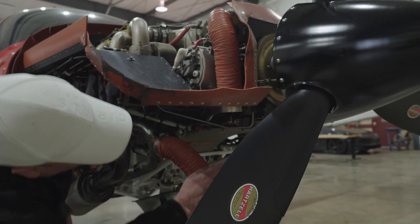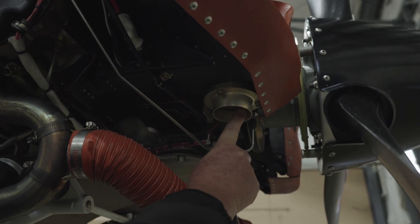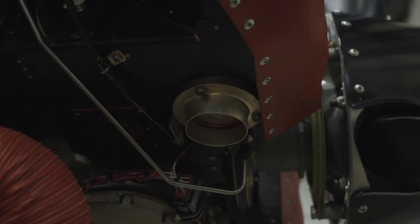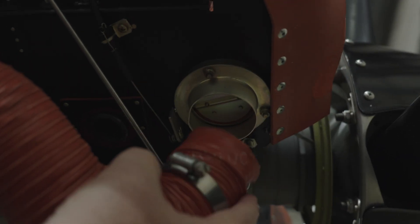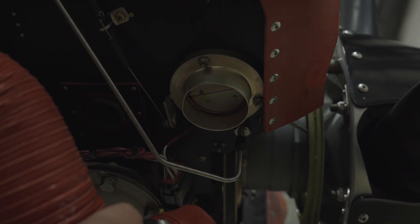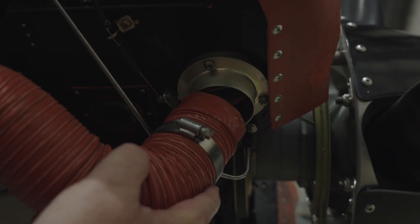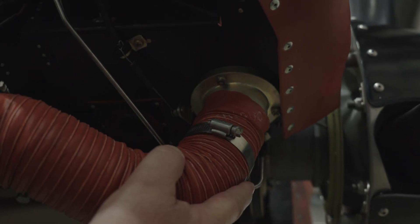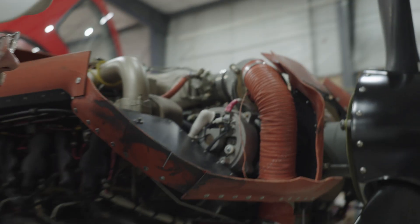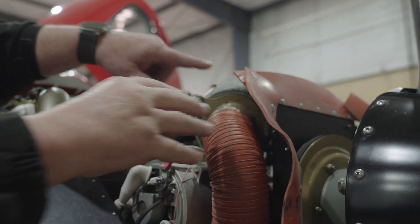So this is where I've got to offer an apology to you, Tim. I've told people that I don't think it really brings hot air into the engine, maybe warmer air from the cowling. But I was ignorant, not understanding that it actually pulls air over the engine exhaust. So this air enters near the engine exhaust. We would have to move the lever, but it goes through that hole. As Tim opens that lever up, we can see that it opened, and it would have pulled this air right here across this exhaust pipe and then across the exhaust pipe into the hose — the scat tube — and right on up into the center of the air filter, bypassing the filter. That's how alternate air works on the Cirrus SR-22.